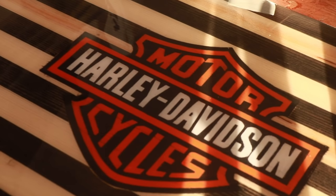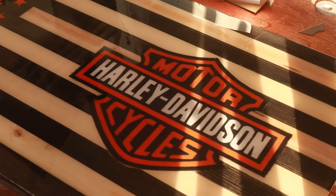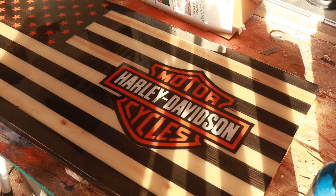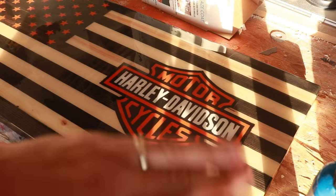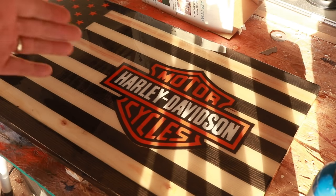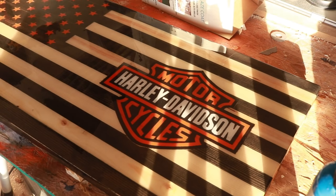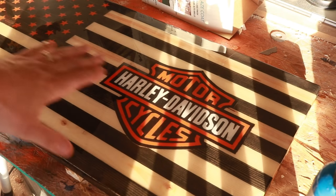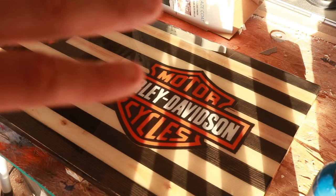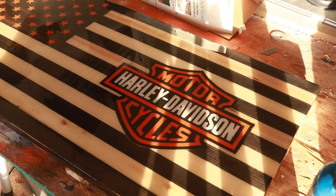And there you go. So we put the second coat on, and eventually what I'm going to do, probably this weekend, once this hardens up enough that I can actually wet sand it, I am going to take some 2000 grit and wet sand it down. Again, I got some fuzzies. It is springtime, so I'm getting a little bit of the fuzzies in the air. It's landing on this, so it's hard. I don't have a paint booth. But what I'll do is I'll wet sand that down, and then I'm going to buff it out. And it should be basically perfect once I get that done.